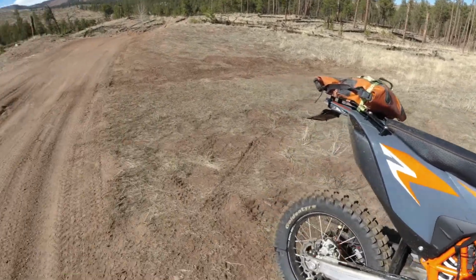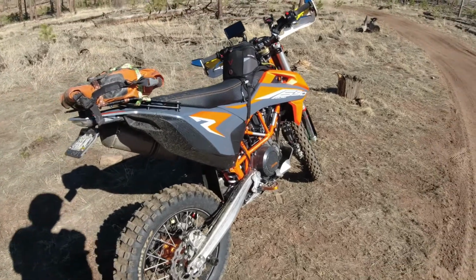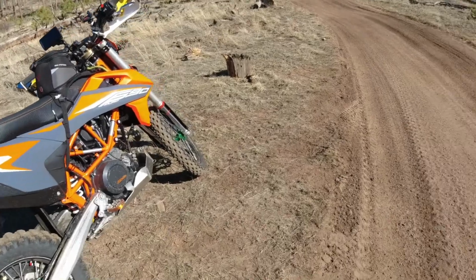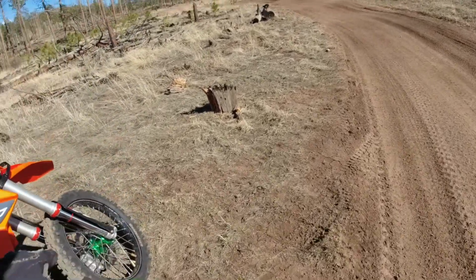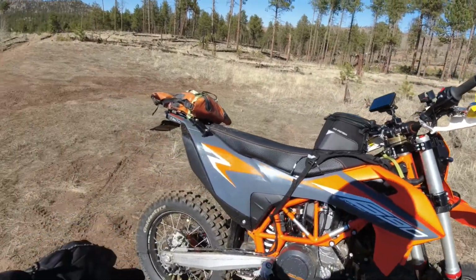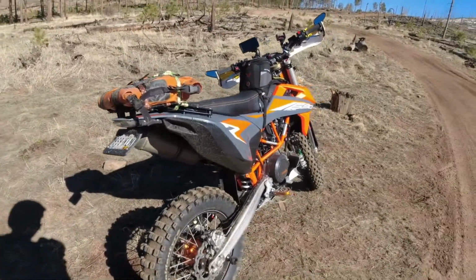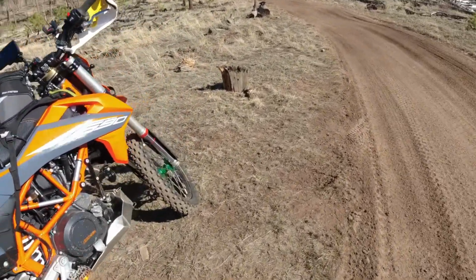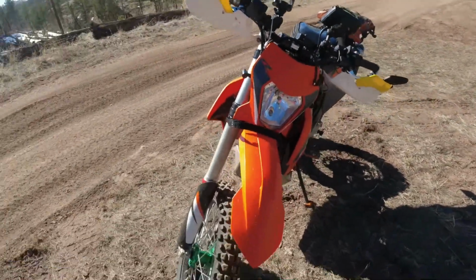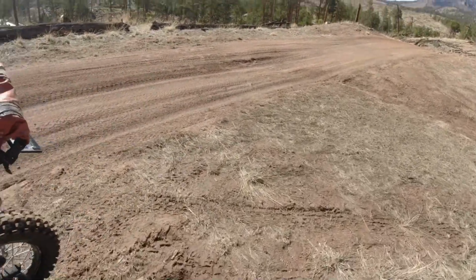Couple other highlights. The wheels, Woody's Wheelworks. I went with A60 rims, front and rear, and those are Honda hubs. The A60s are 1.6 in the front width and 2.15 in the rear. I decided to run a 120/100 rear tire, the Golden Tire 333. That's different, I've never run that kind of tire. And then the Wings exhaust.